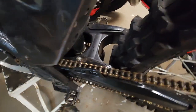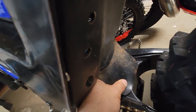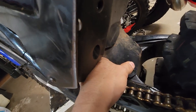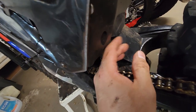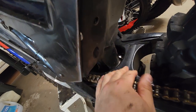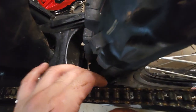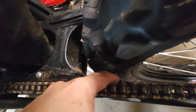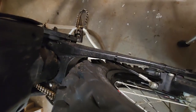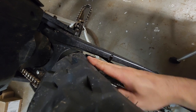When we're trying to get mud out of the swing arm gap, that space matters. I'm also thinking about modifying this rubber piece so it comes down the back and mounts to the swing arm, giving a clear path down so it won't get packed up where it normally does. We took off our guard and shaved the tires so there's no rubbing, and with the knobby tire it actually gives more room for mud to travel down — unlike the trials tire, which is really flat and close and tends to get stuck.